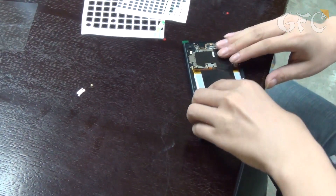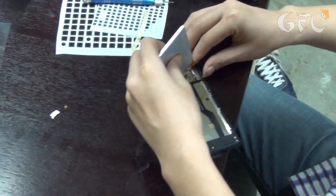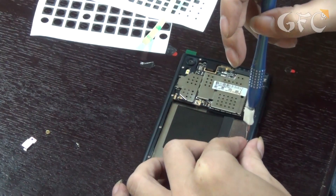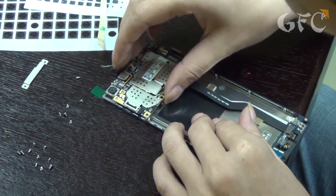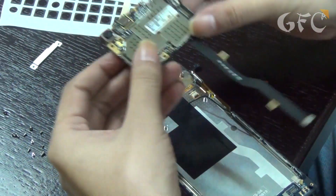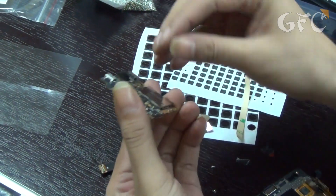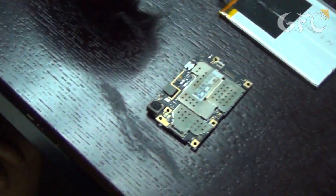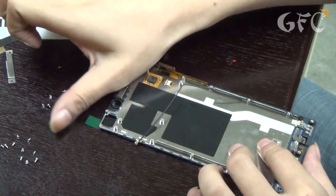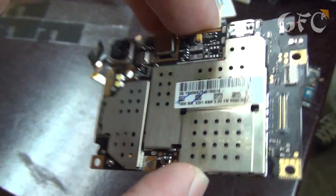The developers not only assemble but also disassemble phones. The back cover is removed with a sharp scalpel. Then they detach the battery and go on in reverse order. They disassemble phones to see if it is easy to do it. During production, workers have to disassemble defective phones or in case of repairing. So the developers think not only about quick and cheap assembling but also quick disassembling and repair. On the conveyor assembling and disassembling are much quicker — every worker has instructions to do a couple of actions, doing them automatically and more precisely.